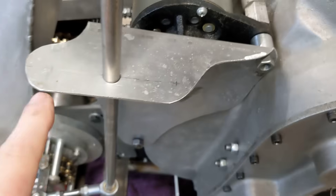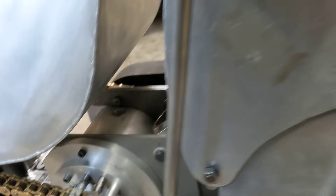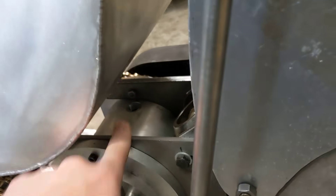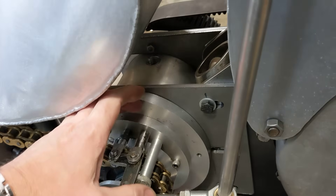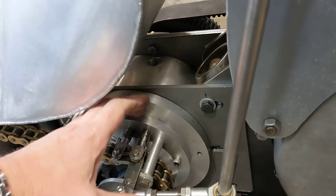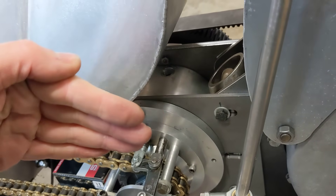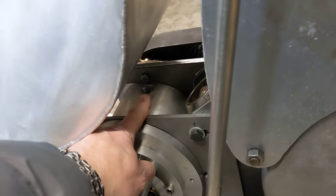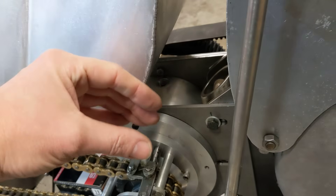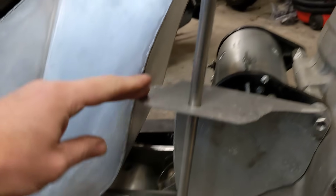The final thing will be to put the notches in that the gear stick will go into. What we've found is that the detent on the gearbox probably needs a much stronger spring, because we'd like to know when the gear selector has taken the dog as far as it wants to go to select the gear, but we don't want to put more strain on it than that. We don't want to be permanently pulling the selector towards or away from us, putting strain on the selector forks.